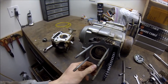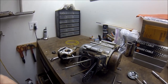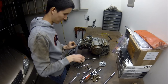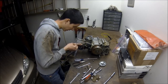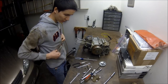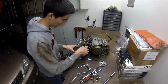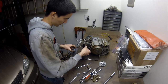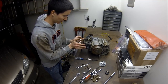He also said that he wasn't sure if the rings were put on correctly — up and down wise. So I'm going to pull the jug off here and have a look at that too while we're here. Head gasket slides off, cam sprocket can come out. I like to grab the roller with a pair of needle nose pliers, take the bolt out, lay that all together, and at this point you can just slide the jug right off.